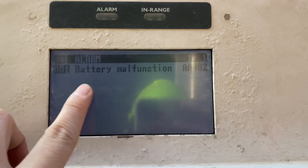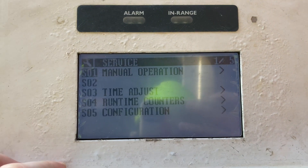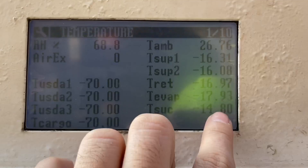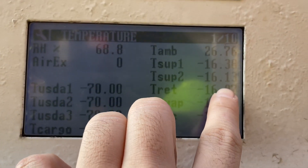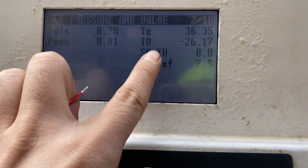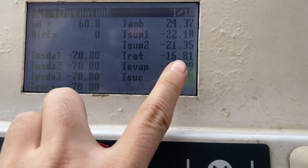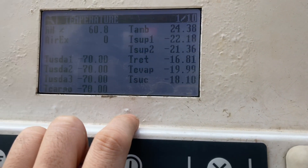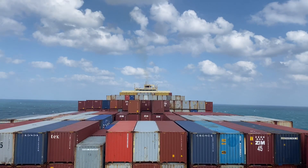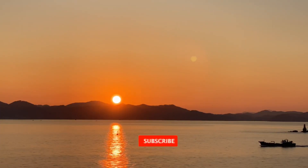After changing the controller, the alarm for HPS K8 switch was cleared and the unit started running in good condition. The pressure read 8.2 bar, and after running for around 30 minutes the unit went in range. That's it — I hope you learned something from this video. Please hit the subscribe button and give a thumbs up for more troubleshooting content.